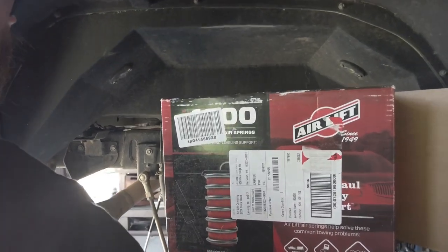What's going on guys, Steve here with Adventure Off-Road X and got another little project for us today. I ordered some airbags I saw online with pretty good reviews. Having the rooftop tent and being completely packed down, it sags a little bit. The biggest issue is when you do springs meant for off-road use instead of stock springs, they're really not meant for loading up. What these do is go in between the springs and give it that lift it needs.